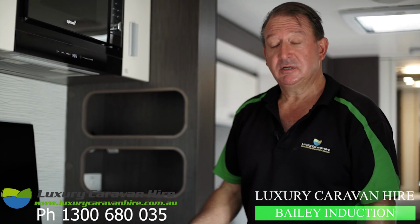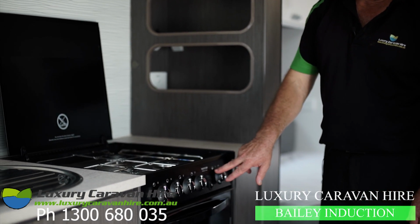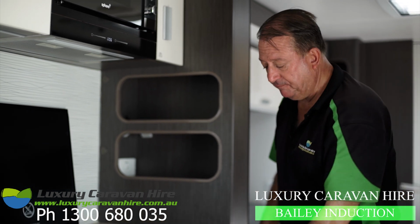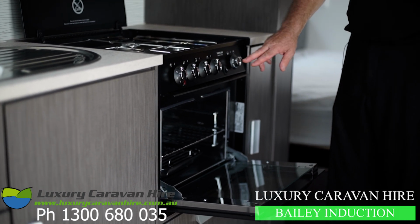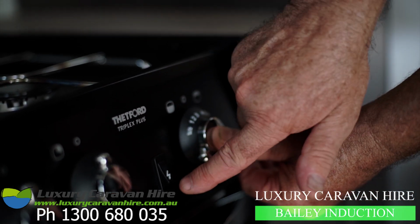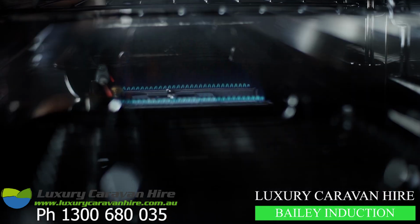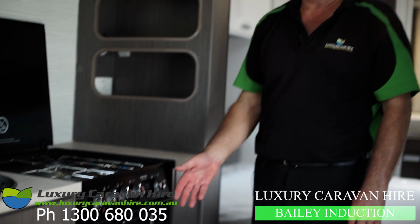The operation of the oven is very, very similar. Oven switch over this side. Now if you look on the knob, you'll see that it has an upper burner and a lower burner. We might operate the upper burner because you can use that as a grill as well. So we'll just open up the door to let out any gas that might be there. As we're lighting it, press and hold the gas button, press the igniter, keep holding the gas knob. You can hear the gas flame burning, and that now can operate as a grill.